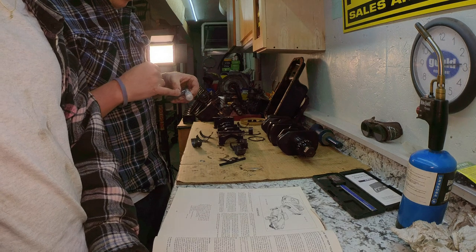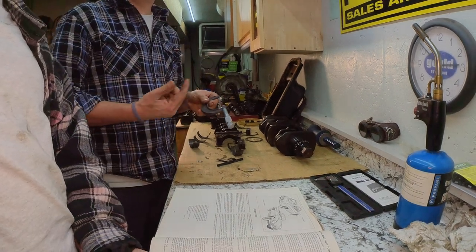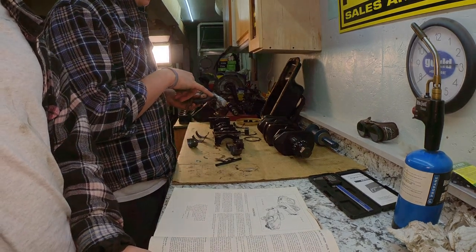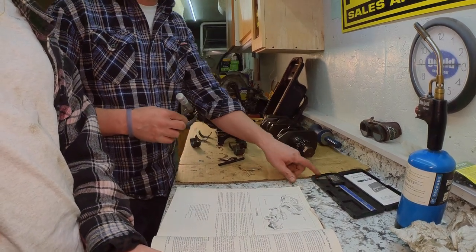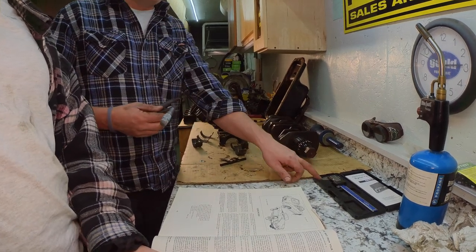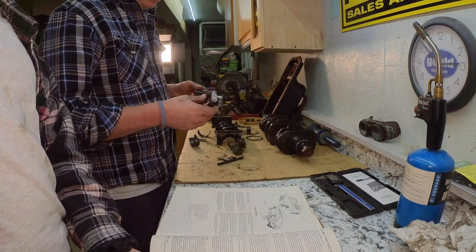Of course, nowadays they've got all digital. We still use these at the shop, absolutely. The accuracy of this should be in the manual, but it's probably give or take a thousandth, or maybe a half, though that's questionable. So this will be tenths of a thousandth in there.